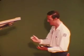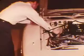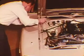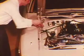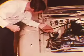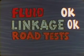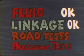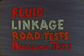Unfortunately, repair order instructions are sometimes vague and the customer's version of the trouble can be misleading, so you could have to do your own detective work. You may recognize the reported condition from past experience, but where there is any doubt, first check the fluid and linkages, then run a road test, and if necessary make pressure tests before you consider opening the transmission. Checking the fluid and linkages first eliminates them as possible trouble sources, but if the road test results are not conclusive, pressure tests in the shop may be needed to pinpoint and verify the trouble.